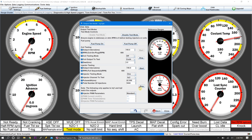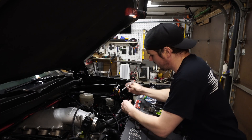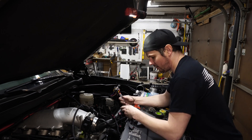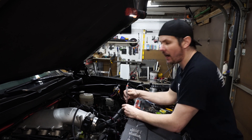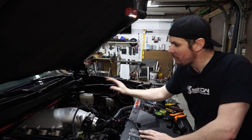If we come in here on the laptop and hit stop, we're going to change over. We got one bank — now we're going to go over to injector two. We'll go ahead and start this one. You can see it's pulsing on the display. Now if we come in here with our test light, same ordeal, and check our grounds, we should see a flashing light. There's one, there's two, there's three, and there's four. Our injectors are all wired out good — we should be good to go.